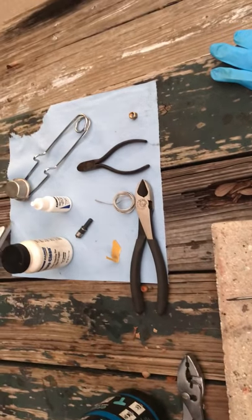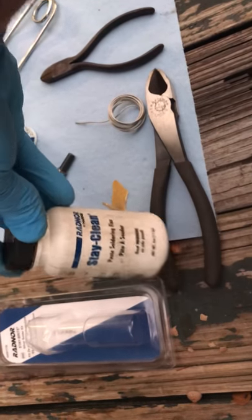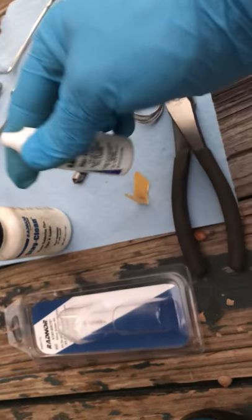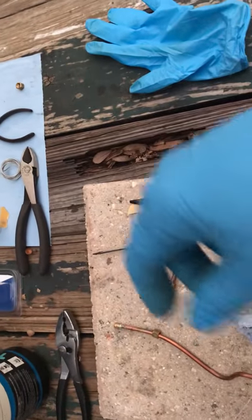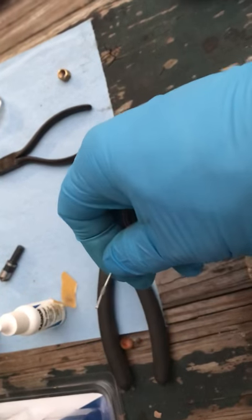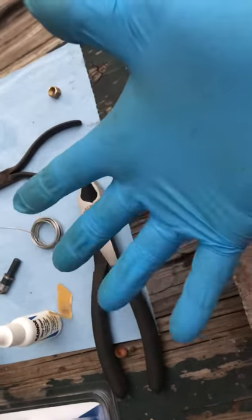Here are some of the other things I like to use. I get this silver solder from the local welding supply — this is Radnor Stay Bright silver solder, and it comes with a paste flux which is fantastic. This can has lasted me for years. It also comes with this Stay Clean acid flux — it's a very liquid acid flux — and I like to use that for cleaning parts. After I took apart the part I re-soldered, I cleaned it off with sandpaper bits, a clean rag, and then the liquid acid flux to ensure good adhesion. Keith Appleton has done some great videos on YouTube about silver soldering, and there's good written material about it in Kozo's book.